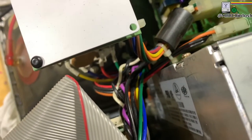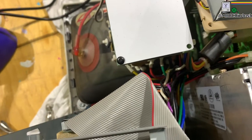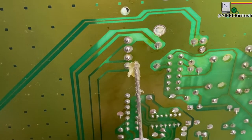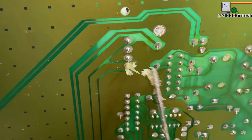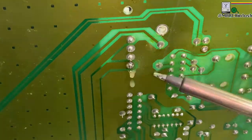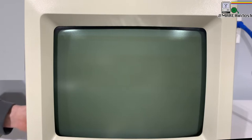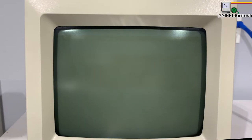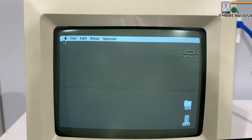I've got the fan finally plugged in. Now I'm going to screw this back down, put it back together, and see if I wrecked anything. This solder joint actually looks like it could be starting to break, so I might as well reflow it. Plugging it in — and flipping the power. Yes! This thing is quiet. I mean, you can still hear it, but it's a lot quieter than what it was.